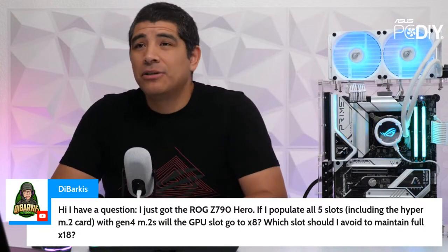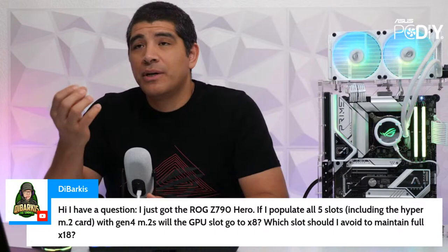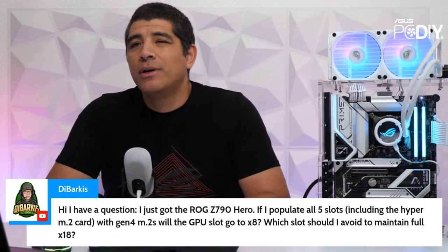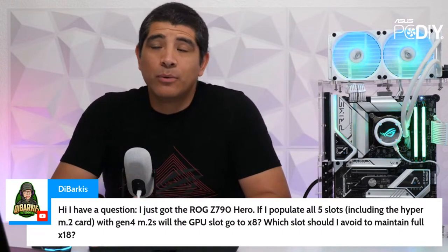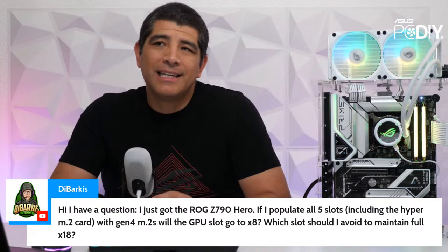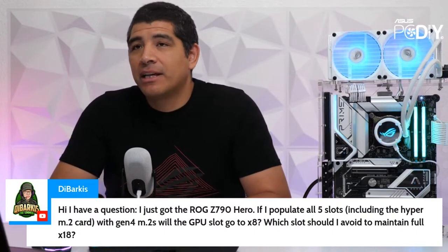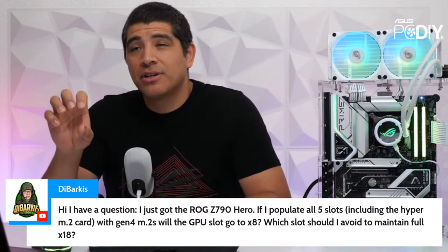And also keep in mind that the effective bandwidth that you're utilizing on your drives is actually very low in most situations, outside of you running some synthetic test in Crystal Disk Benchmark or Atto, which show you a big old number. That's great when you want to validate that the drive's working correctly, but it's not really relevant to your real world usage. If you actually check real world usage, like game loading and application loading, the bandwidth being utilized most of the time is well under SATA speeds. It's part of the reason why, for general game and desktop application usage, you don't really see that much difference between Gen 3, Gen 4, and even the newest Gen 5 drives.